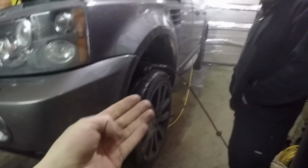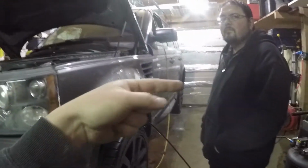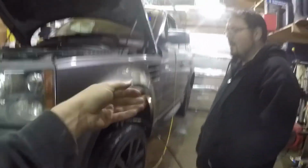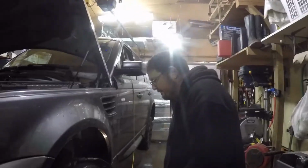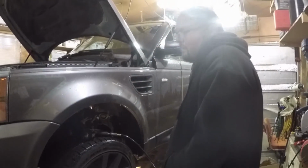And the main purpose of that is so that your strut can fit back into your lower control arm. To remove it, it's perfectly fine because you're going to tap it out. It's mainly when you want to put it back in. It's like fighting with a control arm on regular suspension. It's the same thing, right? Because it's extended all the way out. Yeah, that's true. So this should technically be easier. If we can get the bags to deflate, then we're good.